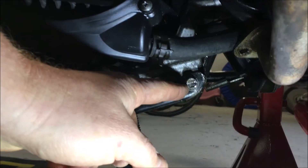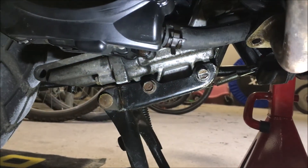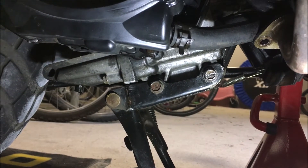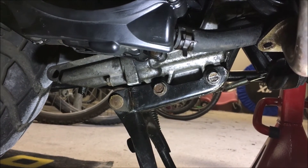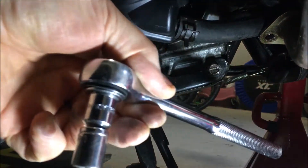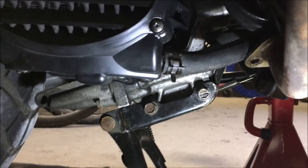So as you can see, this is the bolt we've had the problems with. I've cut it to get a slotted screwdriver in — that didn't do anything. We've tried heat, but it's pretty rounded to start with and now it's in a bit of a state. So that's why we're going to try the bolt remover. I may need to use the impact on this — still waiting for the adapter to arrive, it'll be here later today. We'll try this just with some WD-40 spray to ease it off a bit, and then try a long-handled wrench and see if a bit of leverage will take it off.